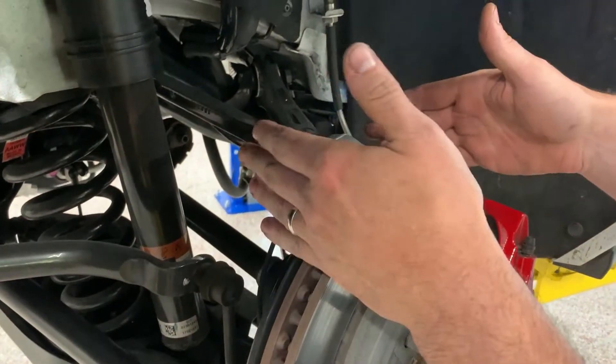Both of those arms are the same. And then this one is the upper control arm. It looks pretty small, but all it has to do is swing. You'll see that it actually has a spherical in it already on one end — so this one's free and moves around nicely. On the other end it's just a regular bushing that goes to the hub. This little control arm is fully boxed in. I know some people replace the uppers, but I don't really see the need to right now — my bushings are still in good shape and it's got a spherical on this end, so I'm going to keep the upper control arm.